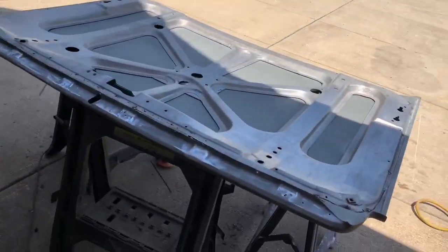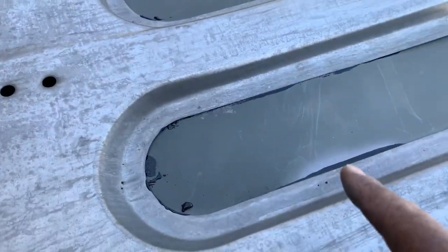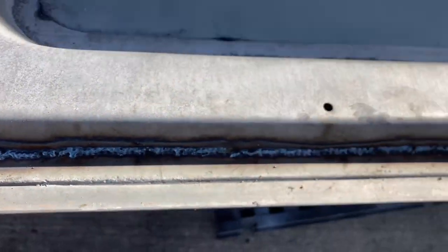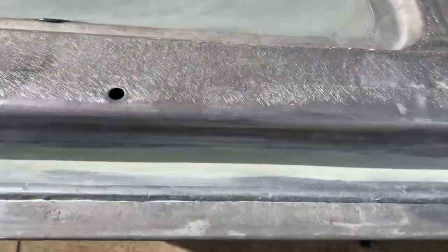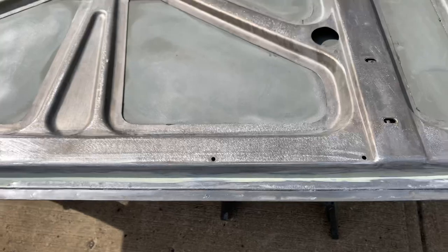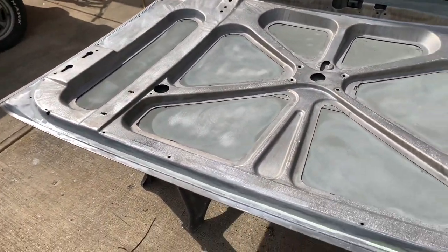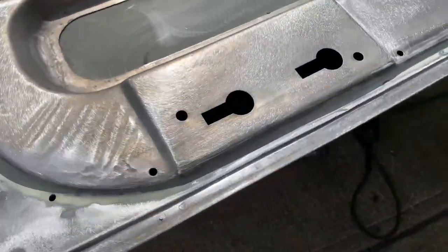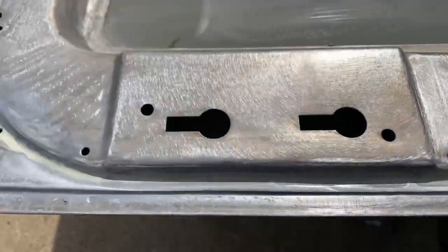Getting in a little closer — both of these panels lined up nice. The panel bonding adhesive is squeezing out kind of like I'd hoped, looks similar to factory. Now I've got spot welding to do all the way around — about 20 feet of weld. This took absolutely forever but it's coming out nice. Buffed those down, put a little body filler in — minimal body filler needed, which is an added bonus. Best part is it's exactly where the weather stripping rides, so I can hide it all behind the weather stripping.